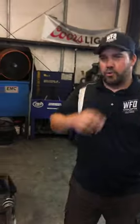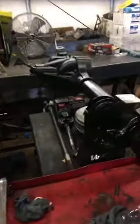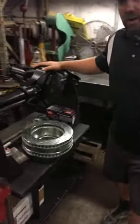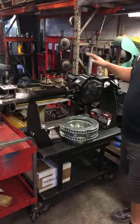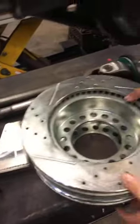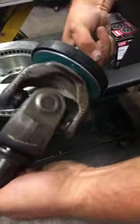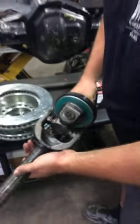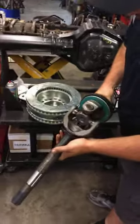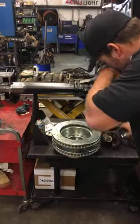We are now direct with ARB, so if you have any locker issues or are looking to get fridges or anything like that, we have all those parts as well. Over here we're selling a full solid axle kit for an 07 Duramax. This is one of our core axles — we stripped it down, we're gearing it, cleaning it, putting all the right brackets on, rebuilding it, and putting it back together to go out next week with the customer's solid axle kit. One of the really cool things: these are the 1550 Spicer axle shafts and U-joints going into this axle. On the new Super Duty 60s, five and up, you can get up to 1550 U-joints, which are way bigger — and it's only available from Spicer.